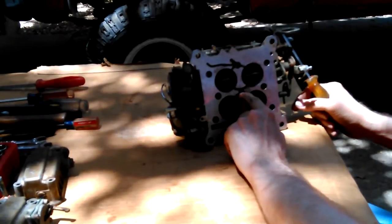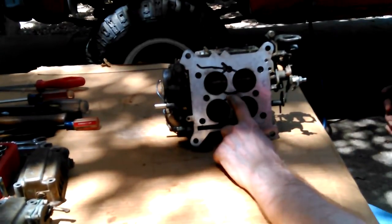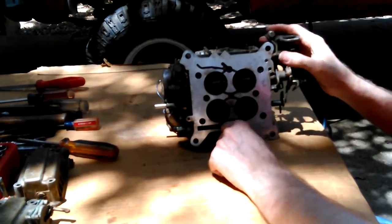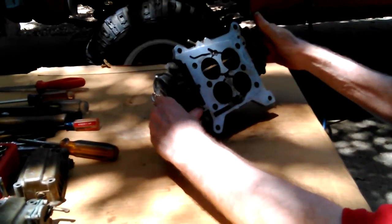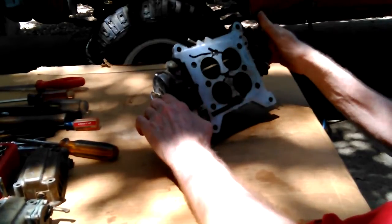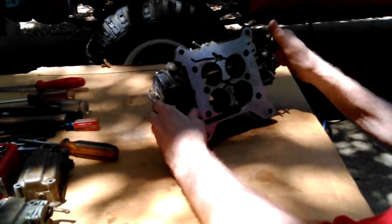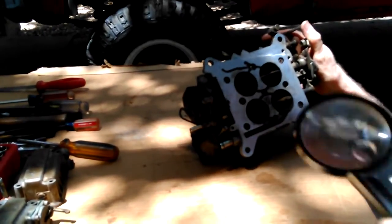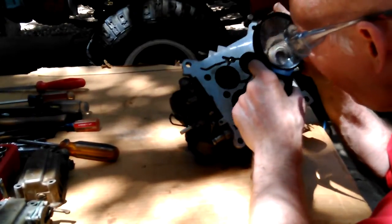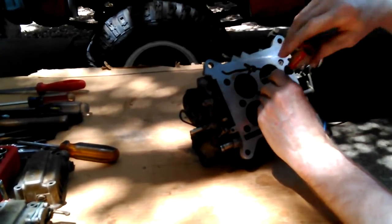There's another jet right there. I wonder if maybe there's only one idle jet and that's it, and you know there's two adjusting screws for each. I never have quite understood all that. There's jets here and here, and those are the main jets. I could figure that much out. And I remember some of the older carburetors, they might have had a jet off to the side up in the Venturis, I remember that. I can't see in there. Let's see if there's anything in them. Well, that's a jet for sure. If he can blow air through that or not. It's pretty tight.